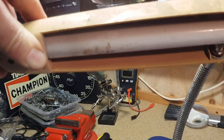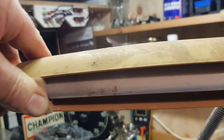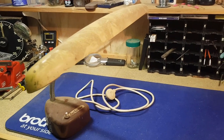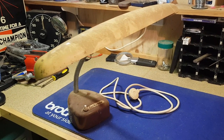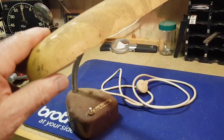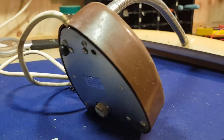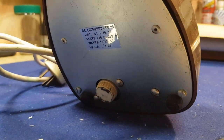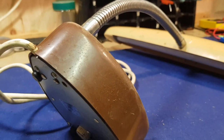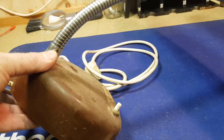The tube looks rather dark at the end, so I think there's a black spot in there. There's a fair chance the tube's no good, or at least it won't be very efficient. So what we're going to do is bring it back to life — a restoration project, possibly not much more than a good cleanup, but we'll look it over and make sure it's safe. We might actually swap out the fluoro tube for a modern LED tube. Having a look underneath, the actual starter for the tube just plugs into the bottom. It looks like it's actually missing one of the rubber feet.